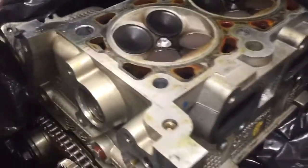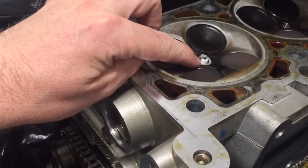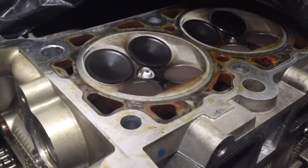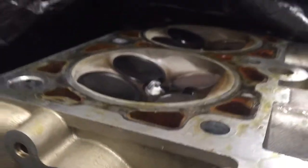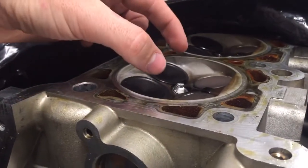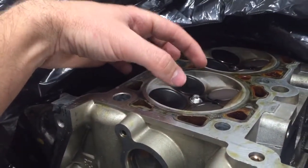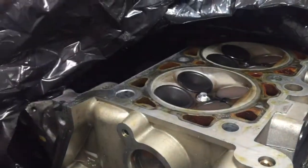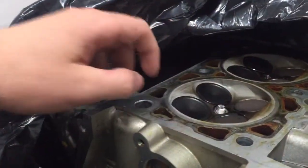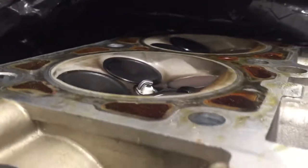What I wanted to show you here is a cylinder head — it's upside down right now, so we're looking at the valves. Here are the intake valves and exhaust valves, and I've screwed a brand new spark plug right in the middle. The valves do protrude into the cylinder quite a ways — if your timing was off or the timing chain had broken and a valve was sitting inside the cylinder, you can definitely have contact and bend the valve. But the spark plug is stationary.